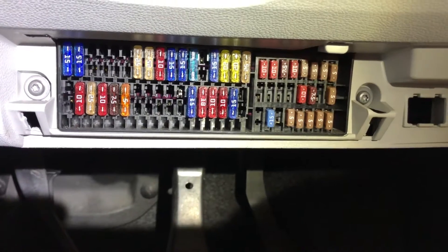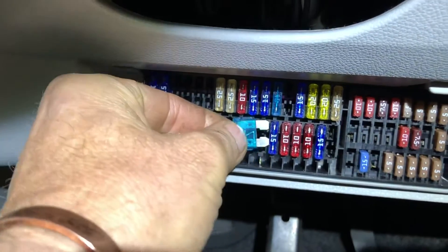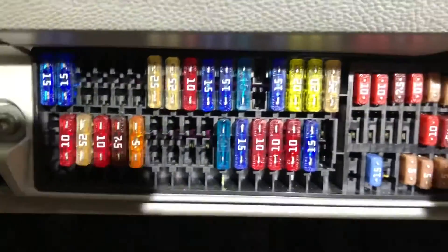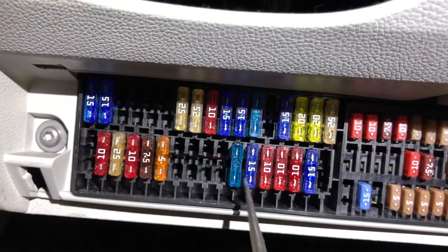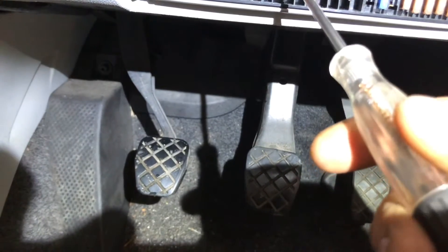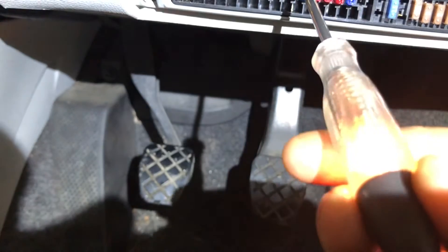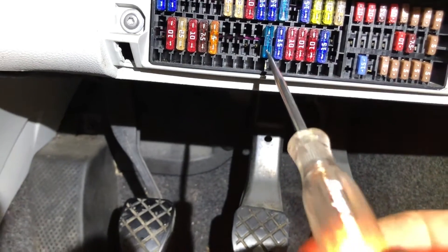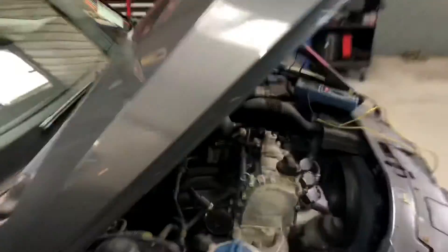Live on camera - will we blow it? It's a 10-amp fuse meant to be in there. I'm putting in a 15-amp for now. Test light - oh, sorry, it was just hard to back-probe - but yes, we have power coming through the fuse. We'll go back out and have a fast look under the bonnet to see what we have without back-probing anywhere again.